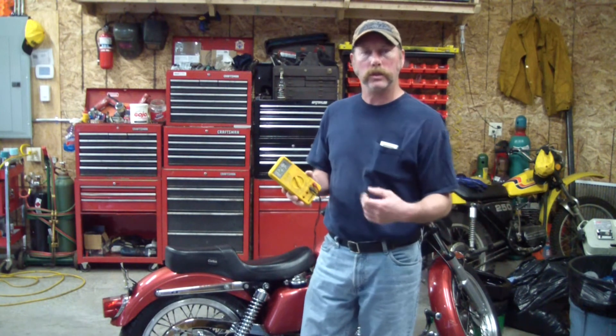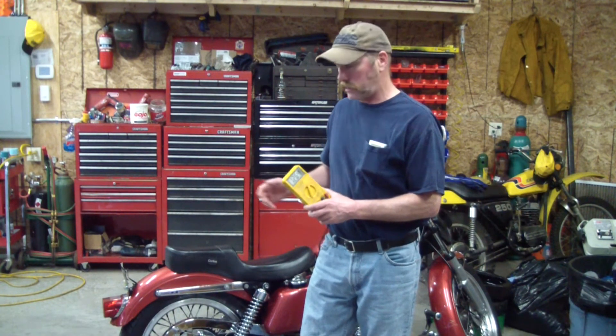What we did — since the battery was sitting on the charger a while ago — we wanted to make sure that the battery was going to be charging up to full charge, which should be 14 volts while the engine is running. This has an old generator system with the old style voltage regulator. It's only making 12 and a half, so that means the generator isn't producing any more voltage to keep the battery storage up to 12 and a half.